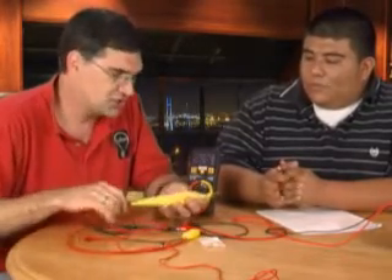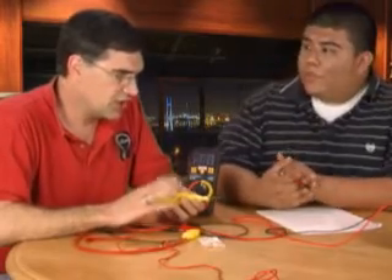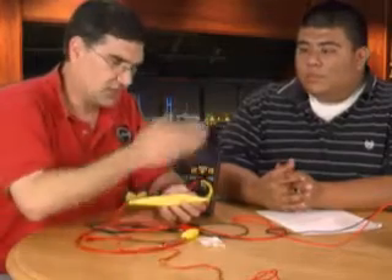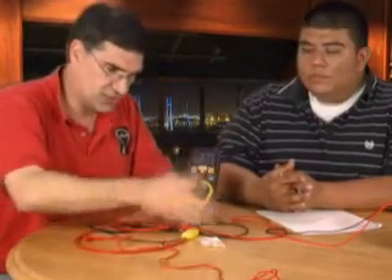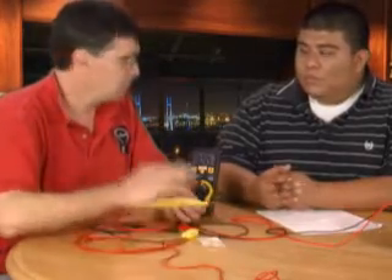Here's the way I explain it for guys who are not sure. If you've ever gone out and changed a part because the manufacturer's manual said to change the part — and this is really bad for ECMs — you go through the whole process, you check here, check here, turn the key on, check here, and it says replace ECM. Well, if you've got corrosion in the wire, you're going to replace an ECM when you don't need to, because the problem is actually back by the key.